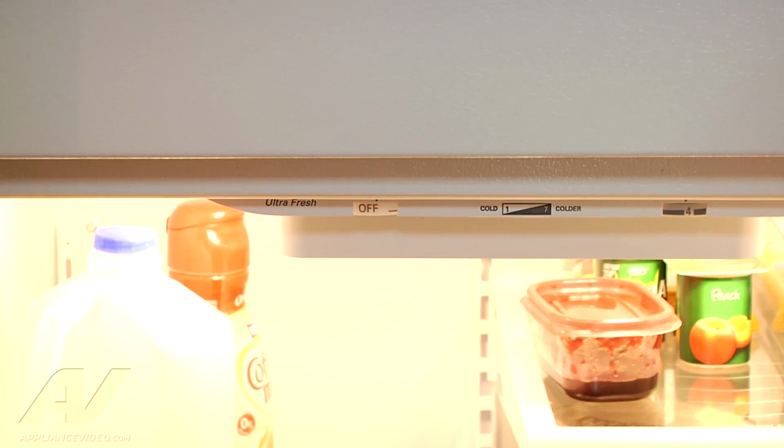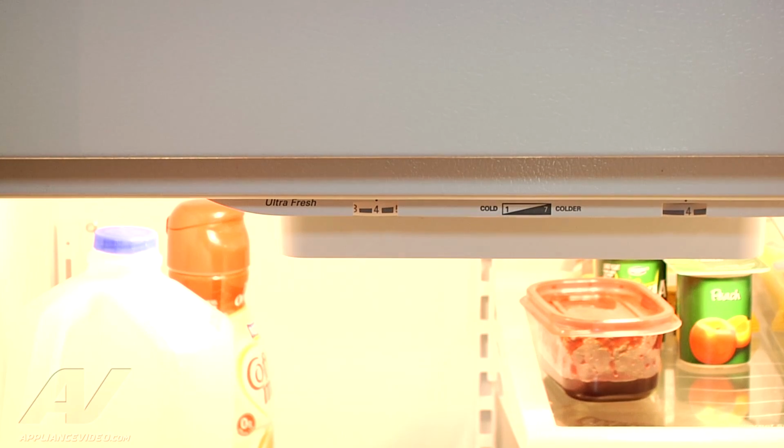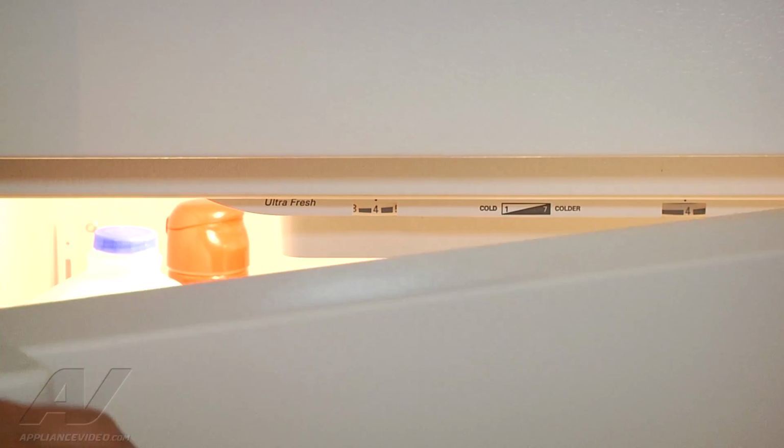Like I said, typically they do get much worse than that, much louder. It'll knock a couple times and bang around. So the only way to fix that would be to replace the compressor, because internally in the compressor, it's just, we'll say it's sloppy. For this unit that's already 11 years old, it's not going to be cost effective. It's a pretty simple unit to begin with. So we'll get the customer the information and see how they'd like to proceed.